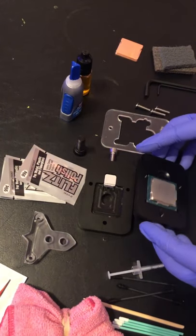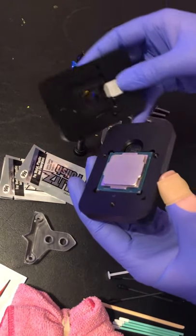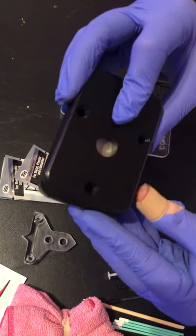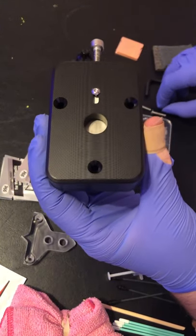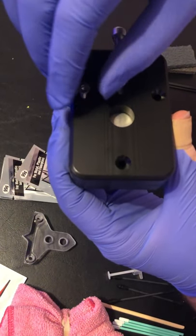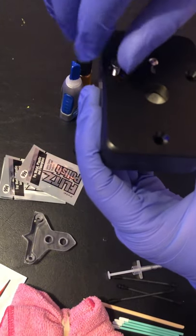The first thing I'm going to do is take my CPU and put it in this little tool right here and clamp the other piece onto it. There's a little rock in there that's basically going to plow right into it and break the IHS off. We're going to bolt these two pieces together with Allen screws — most useless kind of screw.